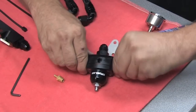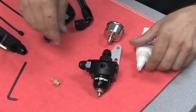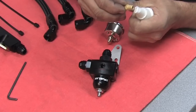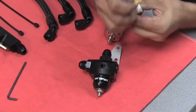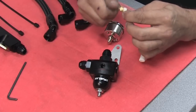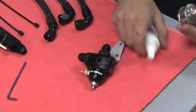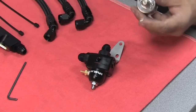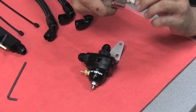This will get locked in place with an Allen wrench. The last two steps are going to use Teflon paste. Teflon paste provides the seal you need to keep fuel and air from leaking. You want to get a little bit of Teflon paste on the pipe fitting and spread it all the way around. The air fitting goes in the side of the regulator, and the fuel pressure gauge goes into the front of the regulator. Same thing again — spread it around, making sure all the threads that are going into the regulator are coated.